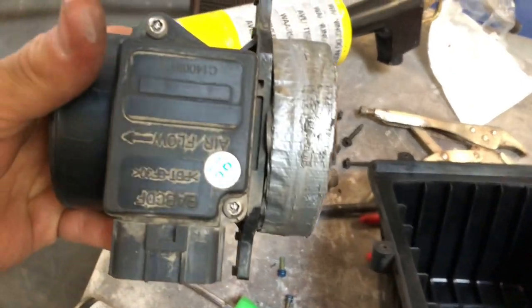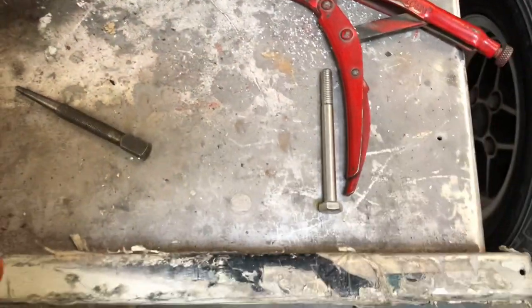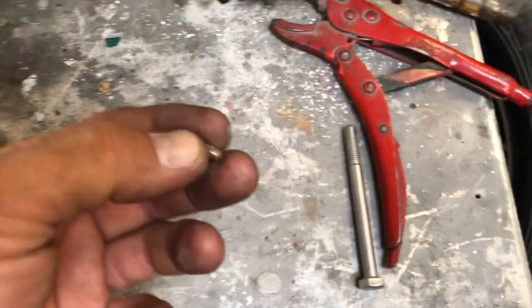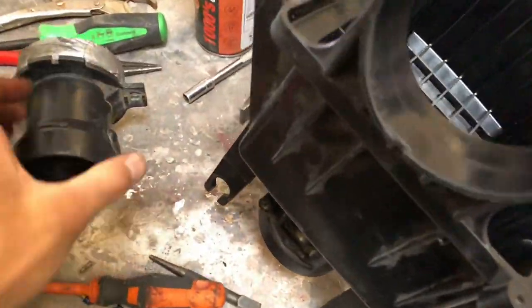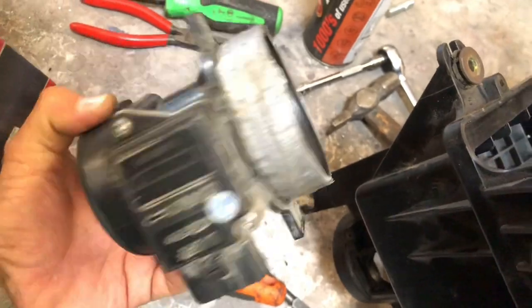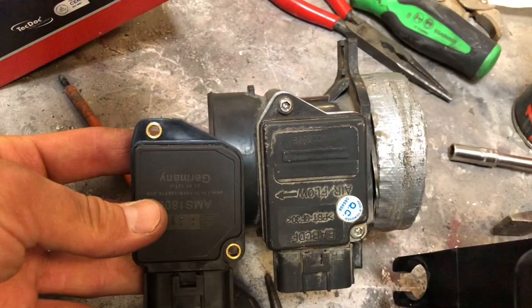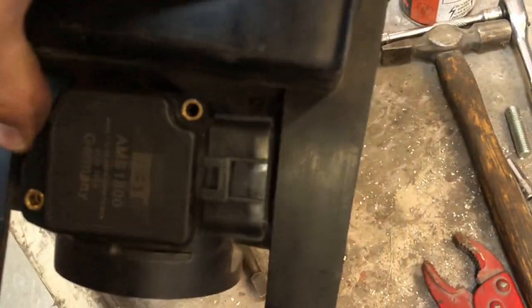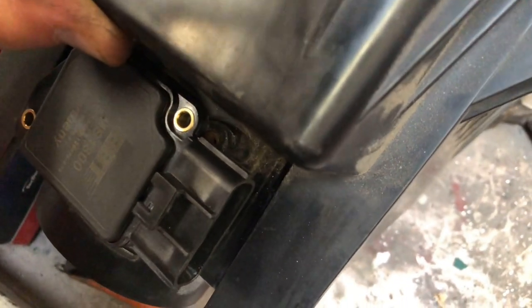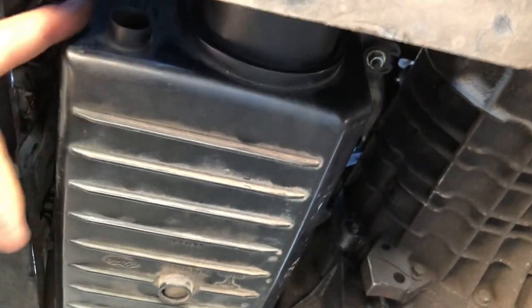The original sensor has different bolt spacing - you can see the top left hand corner of the pattern part is maybe a centimetre out. When you put it into the airbox the top bolt just about gets it but the bottom one is a mile out. The airbox is all fitted now, only mock fitted - I still need to put a new MAF sensor in and we've got an air filter coming. All the brackets are back in place and that's what I wanted.